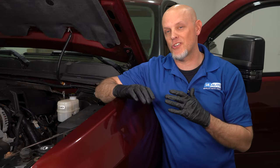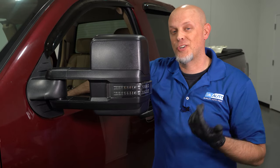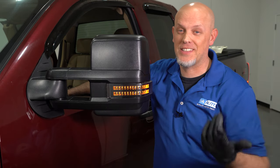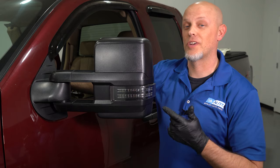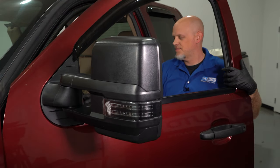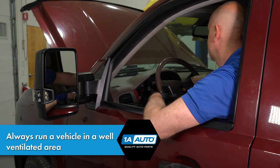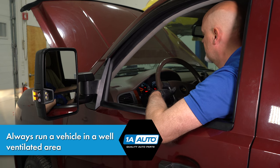At this point, we want to test the lights and make sure everything's working properly. It's going to be easier to move stuff around if you need to now, rather than after everything's all back together. We'll start with the marker lights first — just turn the parking lights on. And those work, so that's a good sign. Check the other side — the other side works as well. Then we'll try the turn signals — and those are working. Check the other side as well — those are working fine. And one more thing: I'm going to step on the brake pedal and make sure they don't come on with the brake. And they don't, which is good. Now we're going to check the spotlights, which we have wired into the reverse lights. Start the vehicle up, put it in reverse — and those work, and they're working on both sides. So that's perfect.